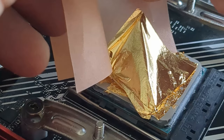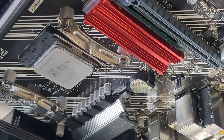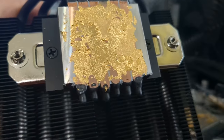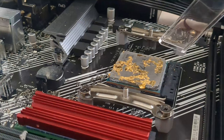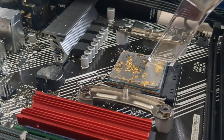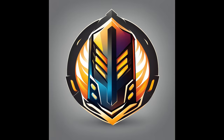I can't say this would work on a higher TDP rated processor — probably not at all — but for this 4700G it worked just fine. Let's take the heat sink off and see what it looks like. As expected, it wouldn't melt at such low temperatures. The pressure pushed it into a decent spread though. Cleaning this off, I'm going to use a vacuum — I don't want gold dust all over my motherboard. Overall, I'd say this is a success: you can use gold as a thermal solution, but only for lower watt processors.